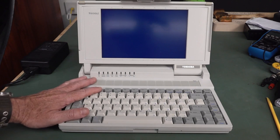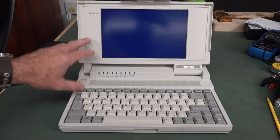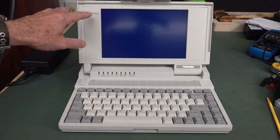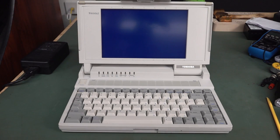What sets the T-1000 apart from the others is that it actually has DOS in ROM. It's got MS-DOS 3.3, or optionally MS-DOS 4, socketed in ROM. So it turns on - boom - instantly. You didn't have to load DOS from the floppies or the hard drive, which took time and space on your limited 20MB hard drive. The T-1000, the T-1000LE, and the T-1000SE were all DOS in ROM.